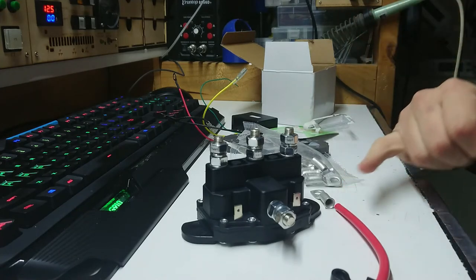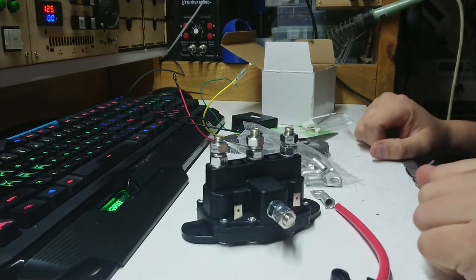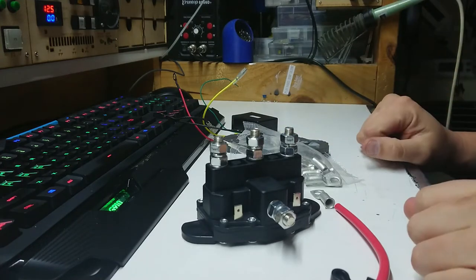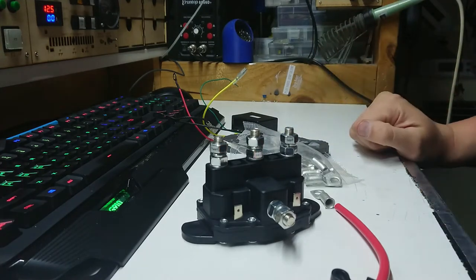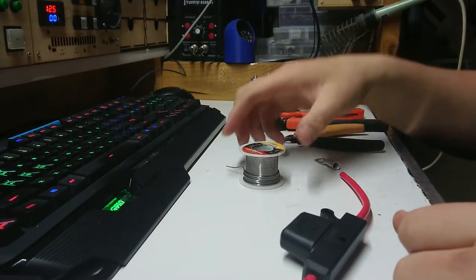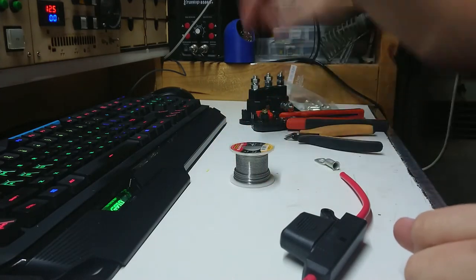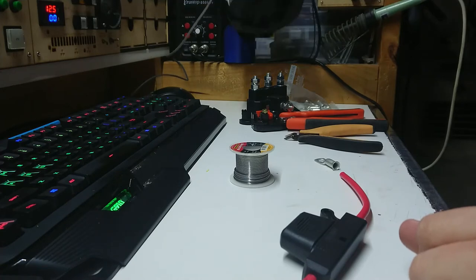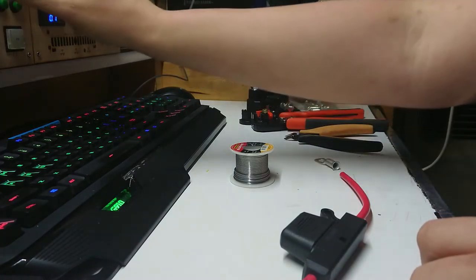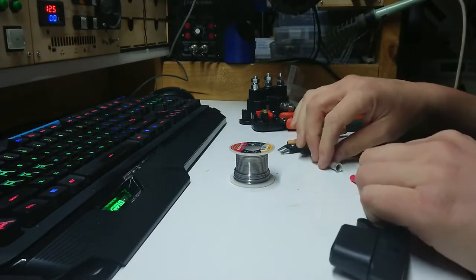Alright, we'll get some of these stripped back and we'll reach over the back here and turn on the good soldering iron. And we'll get rid of some of the extra rubbish off the desk here. Alright, let's get in position to do some soldering. So we're going to get some solder here, which is just pretty much standard 60-40 tin lead. But because there's lead in it, we're going to bring an extraction fan over here. And it is a bit noisy, as you can probably hear. I've got to do some work on that.